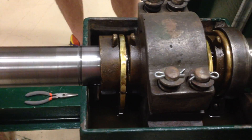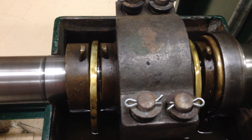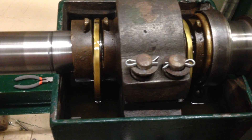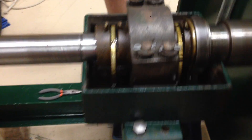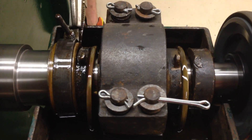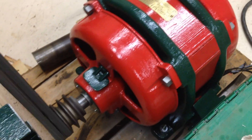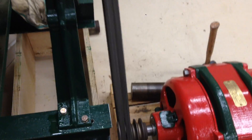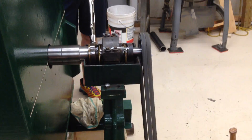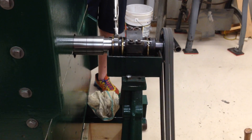As you can see, everything's working the way it should. The rings are turning and putting oil — we may have to rough up one or two of those rings to get more traction because they're not turning maybe as fast as they should. These here are doing beautiful. Our little five horsepower motor is kicking ass. Well, there you go — first start. We'll let it run for 20 minutes or so and see how it runs, check to see if it's warm. The main thing is the break-in of the bearings.